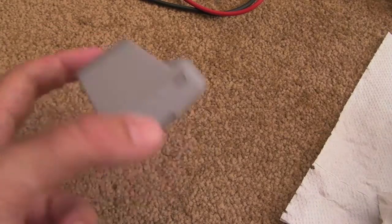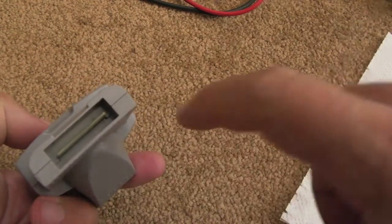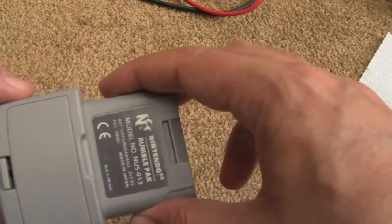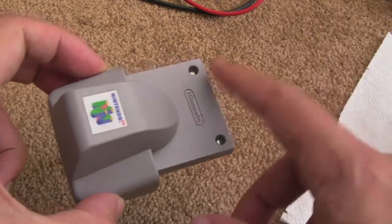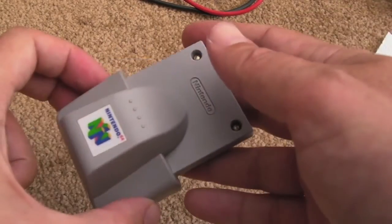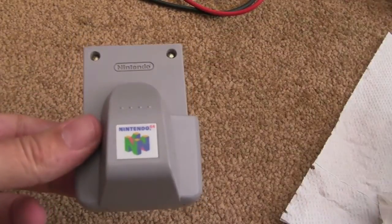Reassembled and all cleaned up. I'm going to clean up where this connects into the game controller now and put some sandpaper in the actual socket side on the controller. It's worth taking these apart — if you've got one that's completely dead, I would suggest checking that fuse first of all. I wouldn't be surprised if that's a relatively common fault on these. Thanks for watching, see you soon.